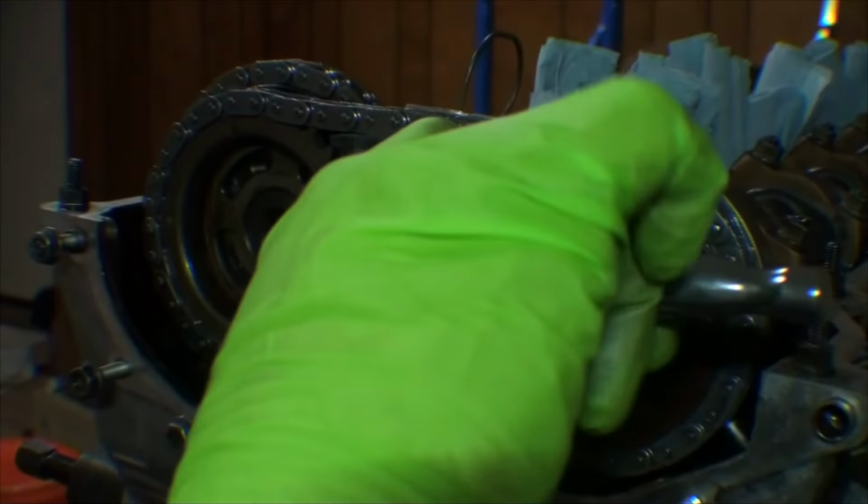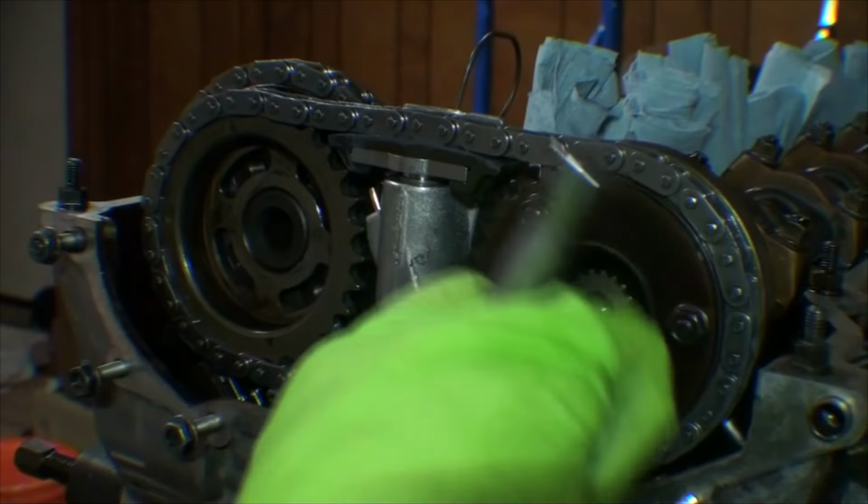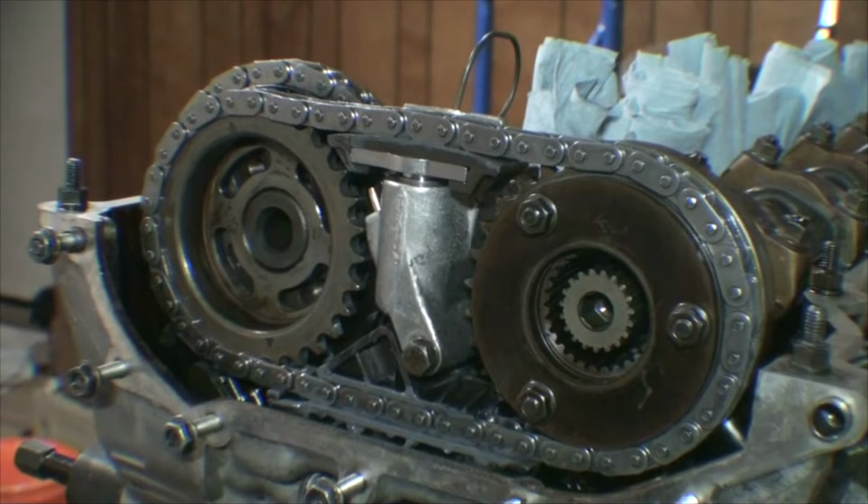Now there is a version of this where it's only, I believe, a 4mm shim, but I don't know how many of those are floating around out there. Most of these cars have the dual plate with the two shims with that washer. It's the most typical. Like I said, these nuts are torqued to 10 newton meters.